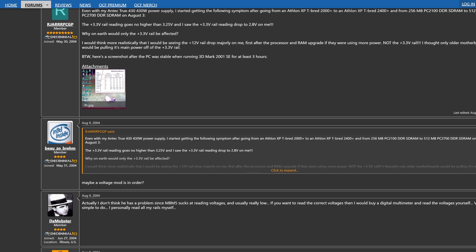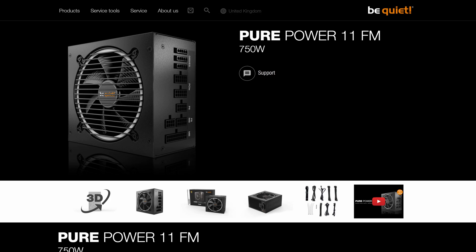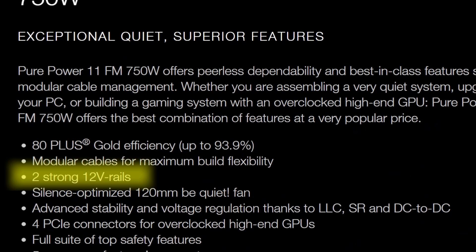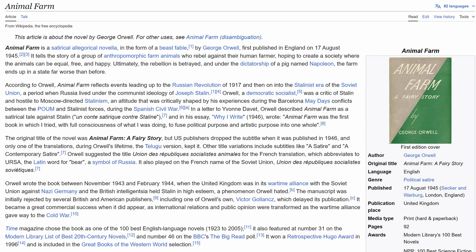So that's why much of the internet and the PSU list from the Cultist Network actually mentions single rail PSUs — because most modern PSUs will power the majority of the hardware from the 12 volt rail. So what does it mean when we say multi-rail PSUs then? Well, a modern multi-rail PSU, like the PurePower 11 FM, actually has two separate 12 volt rails. This can introduce some benefits because a single rail PSU only offers that single 12 volt rail, which could potentially be underpowered if you have a super expensive CPU and an RTX 5090, for example. So technically all PSUs are equally multi-rail, but some PSUs are more multi-rail than others — to totally misquote George Orwell. Having two 12 volt rails is technically better because it allows for more stable voltage delivery than simply putting everything onto a single 12 volt rail.